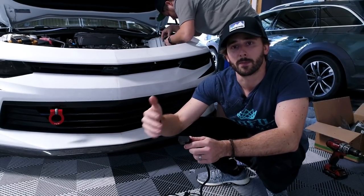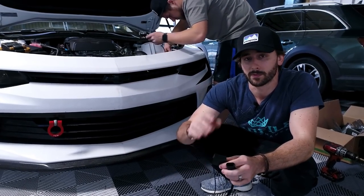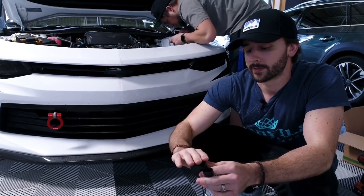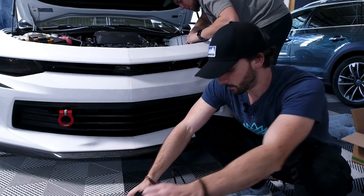Therefore, if your car runs a PWM — pulse width modulated — or daytime running light, or even just a basic low beam circuit to preserve the life of the original halogen bulb, you're going to need this when doing an HID swap to smooth that out and avoid any flickering on the new HID setup through the relays. Very common, very important.